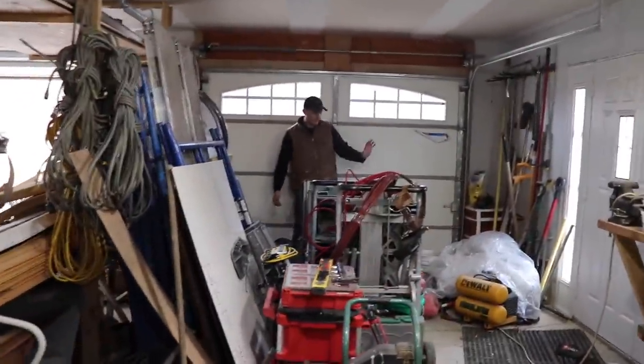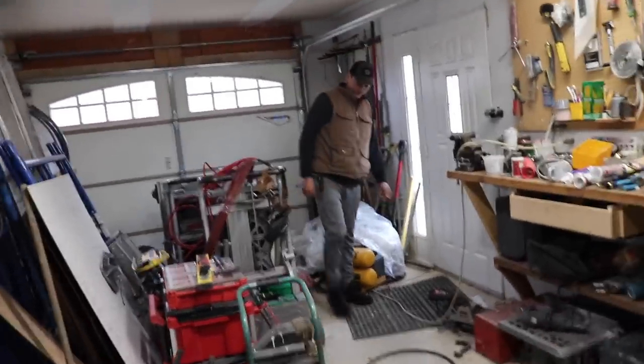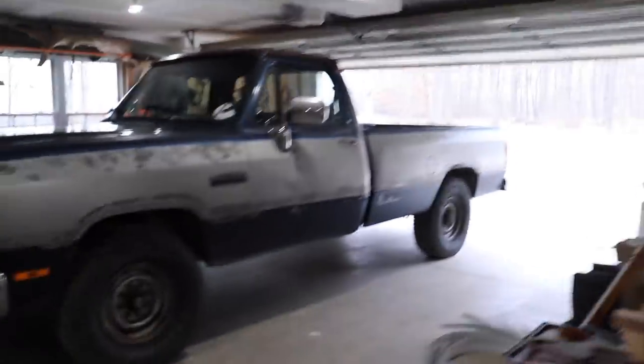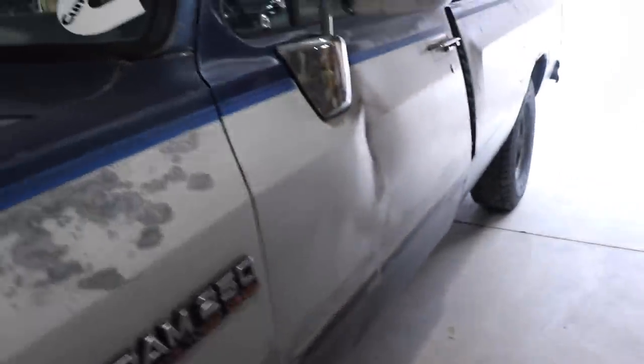What's your review on the dent puller, Jesh? It's pretty good for regular dents - good for dents that aren't near corners. If it's not near any edges and it's in the middle of a panel, you can get it out, as long as there's no crease in the panel. For dents like the ones on my first gen, you're gonna need to weld rods and smack them up - there's just a little bit too tight of a dent for the puller to get a good grab.